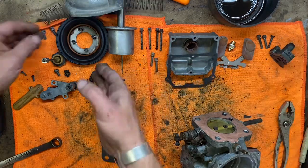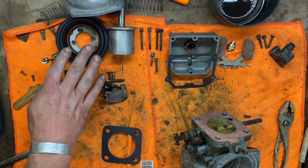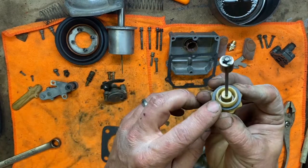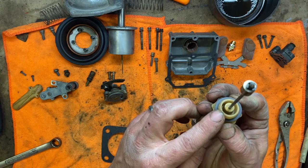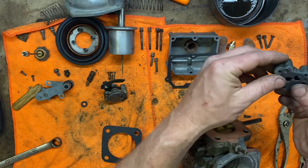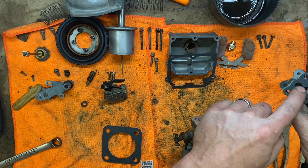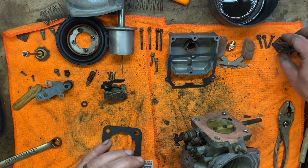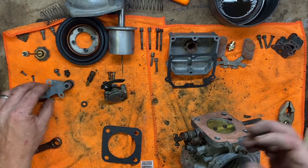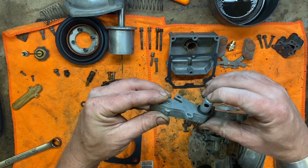This is the bowl gasket. There's a new rubber air bypass valve, the air valve assembly diaphragm. There's a gasket for the top of this damper assembly, which there was not one before. It probably used to be there and was gone. This is the air bypass valve, which explains why it's got this cheater side here with a gasket. And it is spring loaded, so I could see how under vacuum or air pressure the spring would open and it would bypass it.